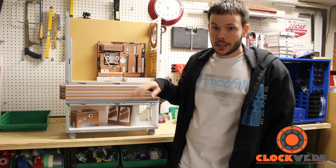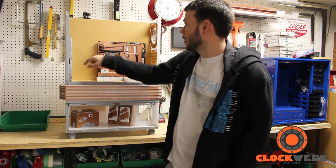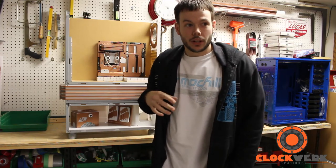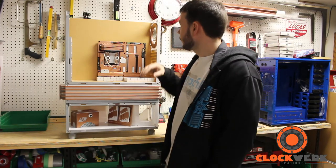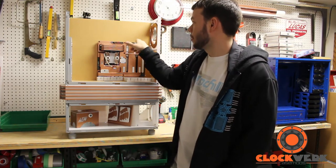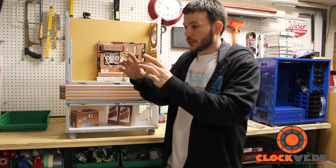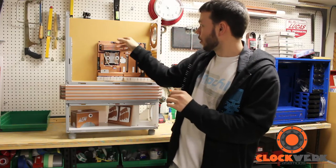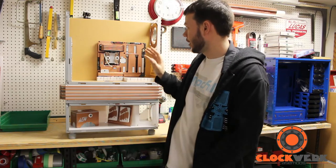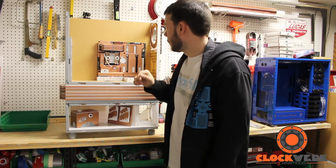Basically now it's like in a framework, and I gotta drill out for the bulkheads in the floor here. I gotta cut out for the radiator. I also have to make some cutouts, once the CNC's back running, I got some parts to get it up and running now. I'm gonna cut out a new motherboard tray. It'll have all the cutouts for all my electrical. I'm gonna make panels that have all the wires. It'll be like an inlet cover for all the cable harnesses, and they'll be sleeved right into that panel, and those will screw in and cover the holes, so everything will be flush mounted and basically look like it was sleeved into the motherboard tray.